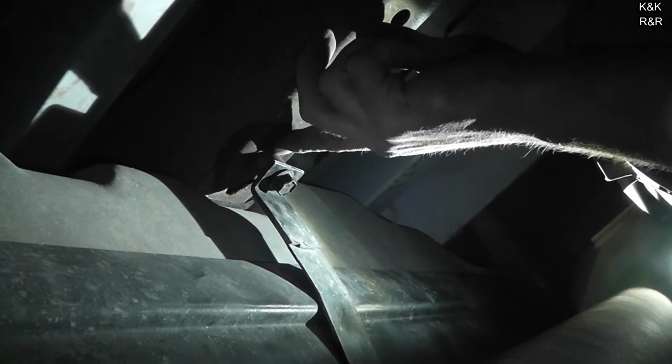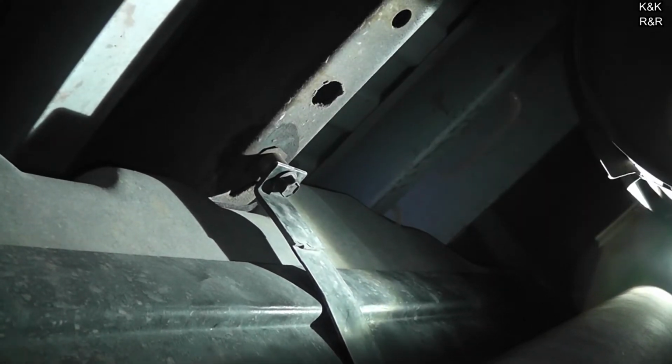Alright, so the spacer that should have been there is one I have in place, but that's fine. I mean, make sure you have your spacer. Whatever you pull out, put back in. I have a feeling when Beer Can Charlie was in there, he lost the strap spacer. Other than that, about 35 foot-pounds, call that one good. Alright, tank is up and we're about ready for final hookups.